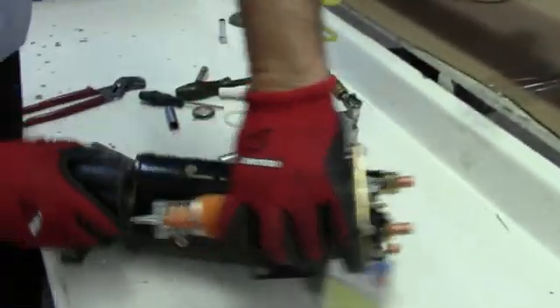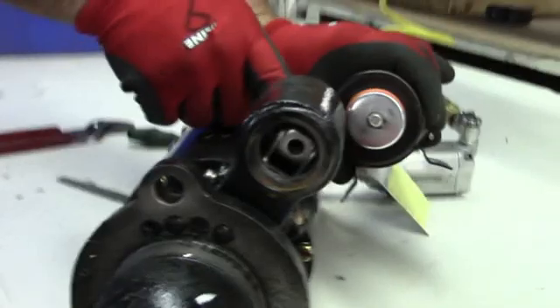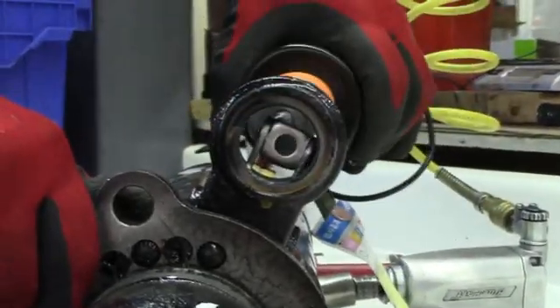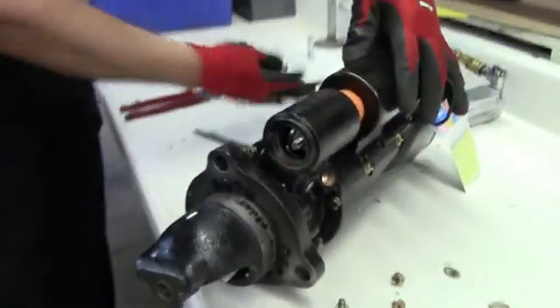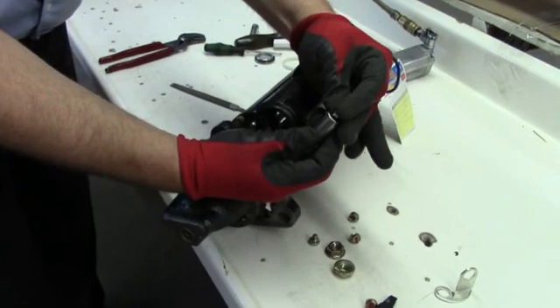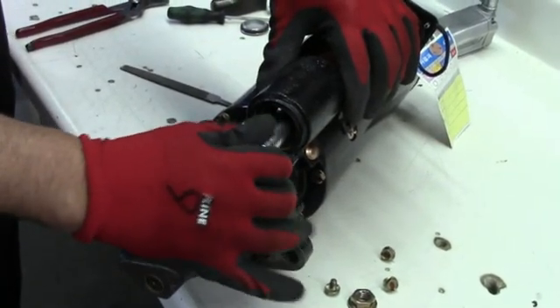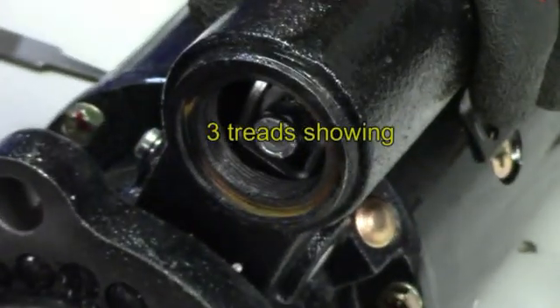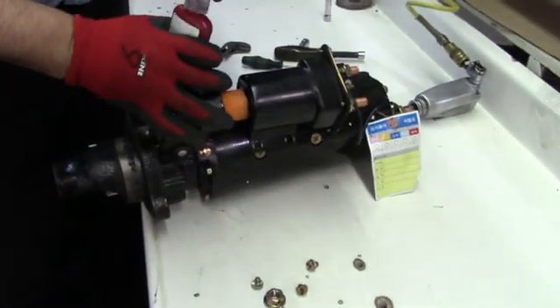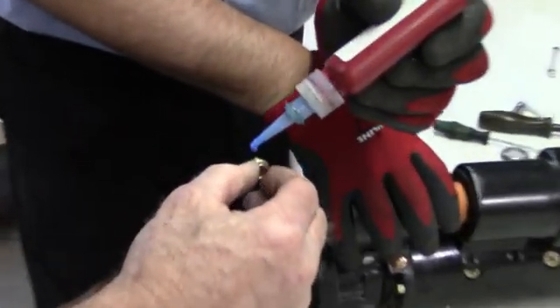At that point it's a matter of reattaching the solenoid. Up inside there's the shift fork that has a block with a hole in it, and that's where the stud is going to feed up and into. Then we can start our nut. Adjust that nut so approximately three threads are showing once tightened into position. Then reattach the solenoid screws using the Loctite sealing process by applying a drop of Loctite on the thread.